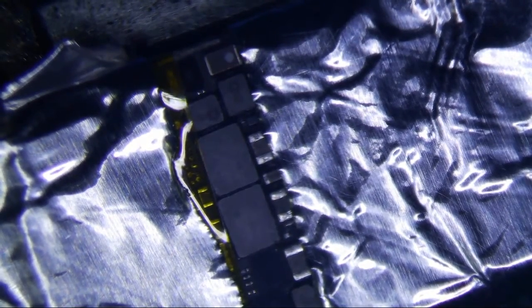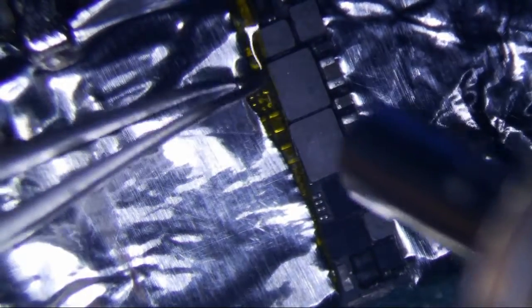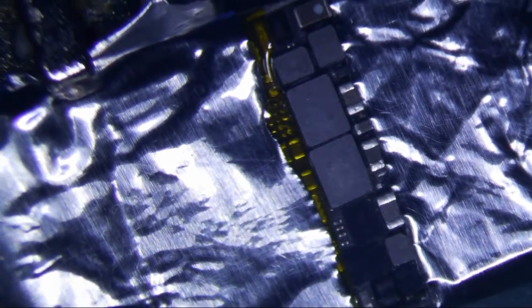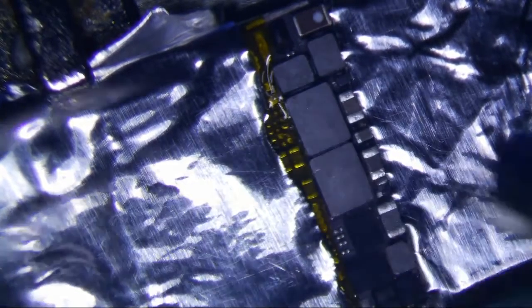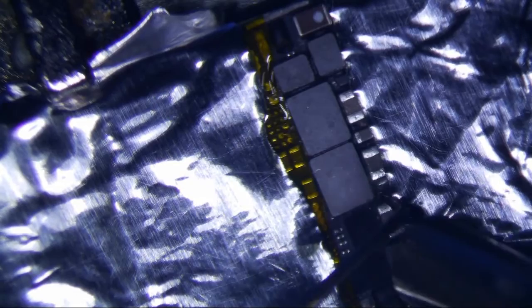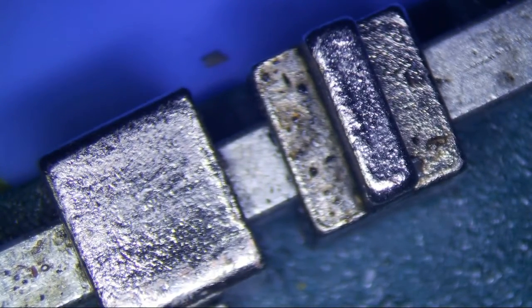So apparently the 6 and the 6 Plus use the same coil. I'm going to turn the temperature up to 500 — that's maximum on my heat gun. I have an iPhone 6 Plus logic board here which I've covered with Kapton and high-temperature foil tape. I'm going to cook it. I've got two chances here. I wonder if I can go to the back side of the board and cook it from there — let's try that.